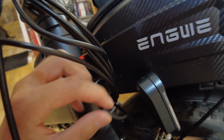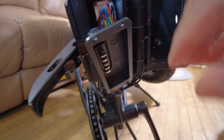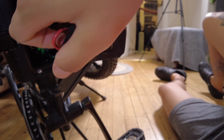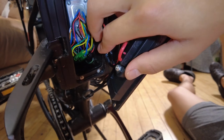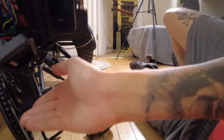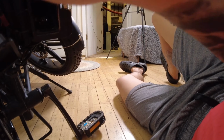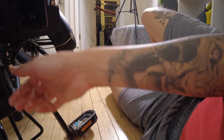What you want to do is you want to follow the headlight cord right here. Just follow this, follow it all the way to your box. And here you can take a look to see if everything is connected. And if it isn't, connect it. Personally, if it looks connected but your headlight's not working and you've had to resort to option D already, I would simply unplug your headlight cable and plug it back in.